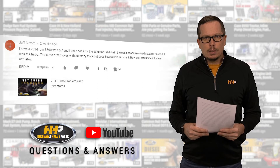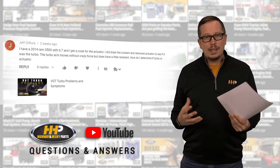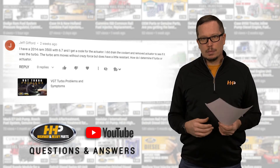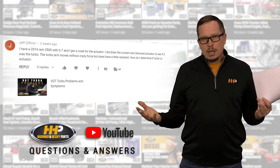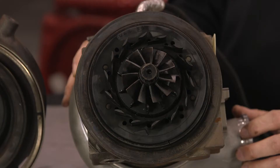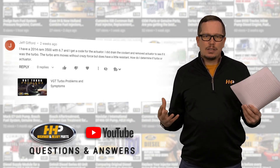When we get into problems with the turbocharger, the vane pack and shroud plate are on the exhaust side of that turbo, so they see a lot of abuse — whether it's from carbon buildup from EGR systems, an EGR valve that's failed, an EGR cooler that's leaking coolant, injectors that are overfueling causing excessive carbon. When something hits that shroud plate at speed, it can actually bend the vanes. Excessive carbon buildup from overfueling injectors or injectors not atomizing properly can cause excessive carbon in the exhaust.